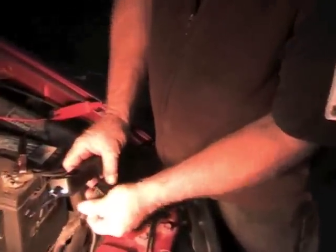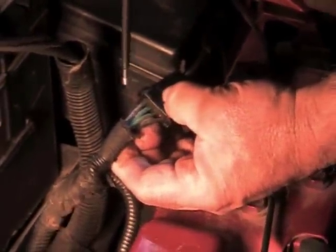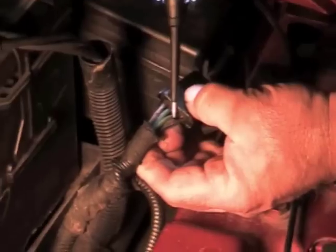So we've tested the cooling fan side. The cooling fans are good — they work when we bypass the relay. Now we're going to test the computer side, or the command side. Going back to the connector. The two bigger wires are where the current flows, so we're going to go to the other side.